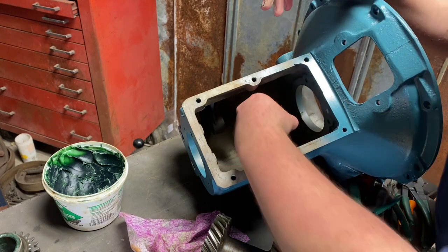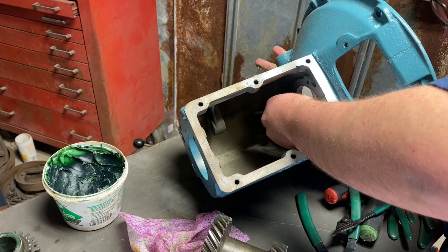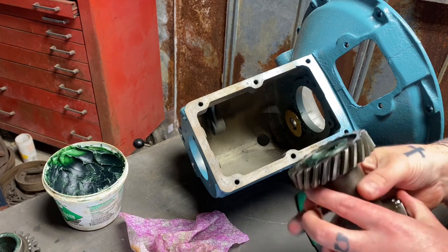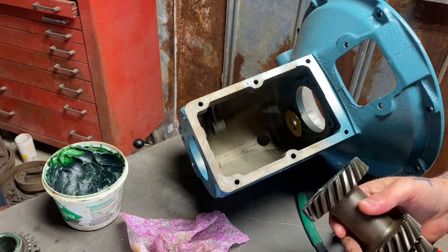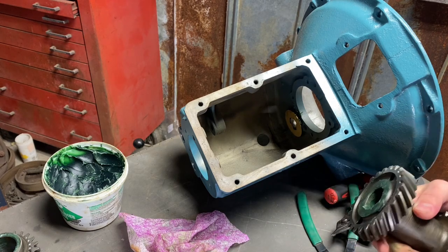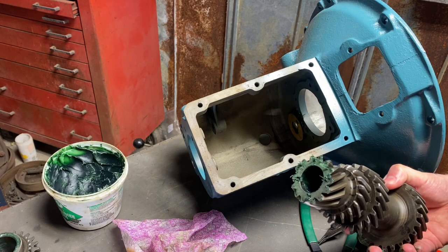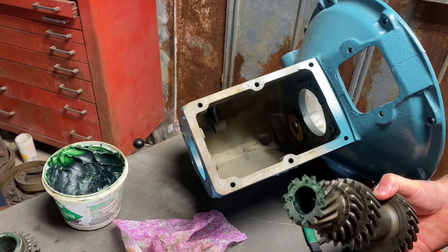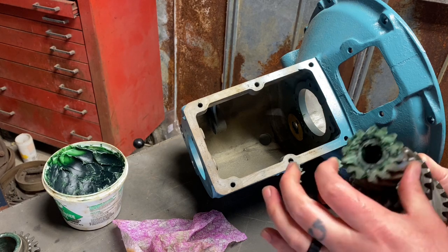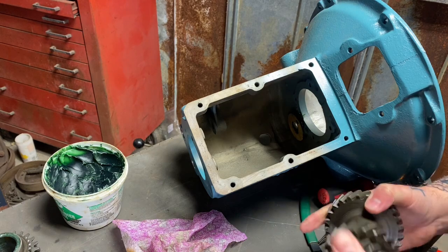So this is a frustrating part, or maybe one of the few frustrating parts of actually doing this part of the process, because when we put in this counter shaft, we're not going to put the rod in. We're not going to actually secure it in place. It's just going to sit in the bottom and roll around as we assemble everything else, because it'll otherwise be in our way. So our 2 short bearings, short bearing completely packed, ready to go. And I'm fine with that excess there. That's going to help stick our washer on.